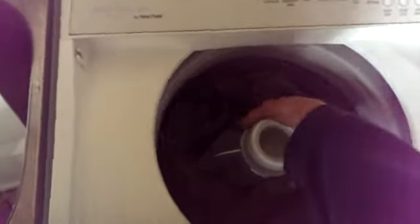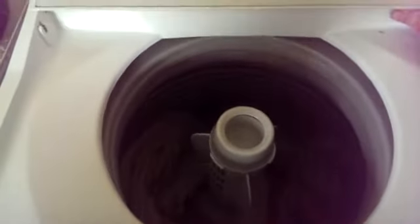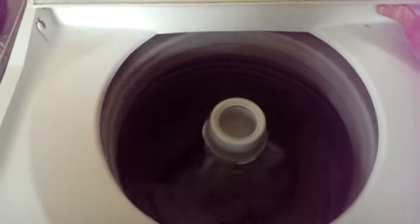A good remedy for this is to lift the lid, leaving the lights on, take the agitator quite tightly and turn the whole bowl around one complete cycle and back again one complete cycle. Then close the lid, and it will spin.